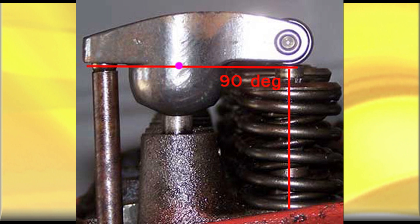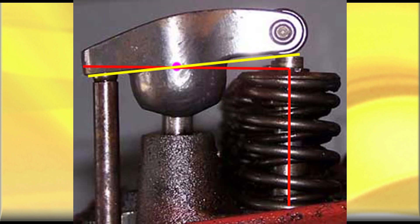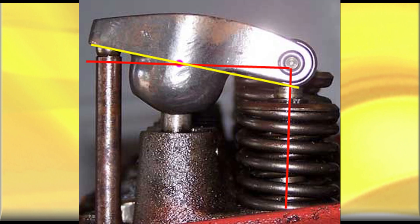Now let's look at some photos taken while working with the roller tip rocker on this engine. Starting with a 202 standard pushrod with a length of 9.016 inch — how close is this to perfect? At half lift, the red horizontal line should pass from the valve tip through the fulcrum center and out to the pushrod socket. A 20 thou shorter pushrod would make this geometry pretty well perfect. Another option is to screw down the lash adjuster a further quarter of a turn beyond the half to three quarter of a turn standard setting. For the valve closed and full lift positions, the next two photos maintain the red line for reference. You can see the rocker is angled upwards towards the roller at the yellow line. When we go to the full lift position we want a similar angle pointing down, and this is very close to perfect. If you blued the valve tip to check it, you should get a mark right in the middle of the valve tip, and the sweep width may be fractionally wider.